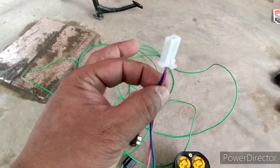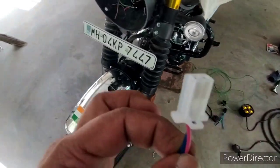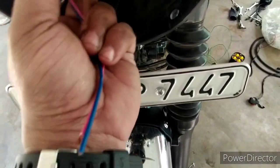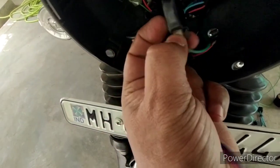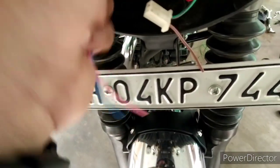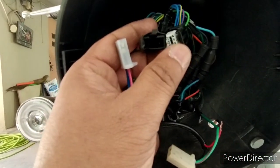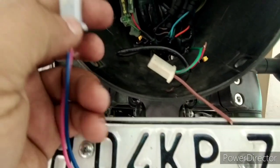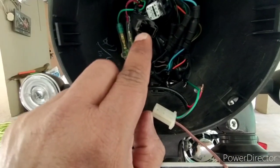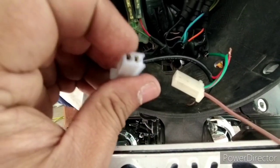The most critical thing is this socket — a 2.8mm 2-pin socket. These are general automotive specifications, and this will help us take the connection from the bike without tampering the wiring. Honda has given an AUX socket, and if you hold the socket, the right side has the main power in it. The stock socket is not the standard automotive type — the legs are far apart compared to a standard one.